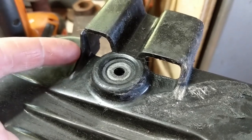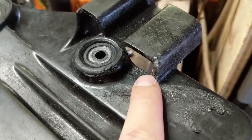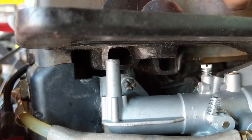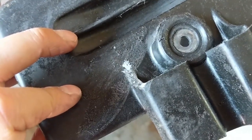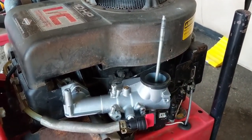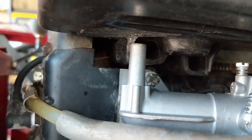There are small supporting brackets that direct air from the flywheel into the airbox — one was interfering with a post so I notched it out with a grinder. Using a white paint marker I marked the new bolt location, but noticed a slight gap meaning I'll need a bushing or spacer to raise the mount approximately a half inch to get a nice flat seal and prevent dirt from getting in. I'm going to check my scrap bin for something to use as a spacer.